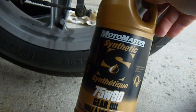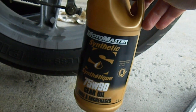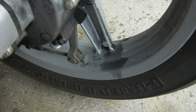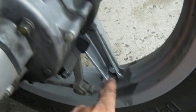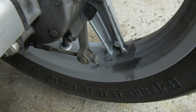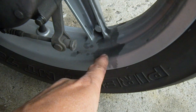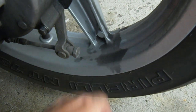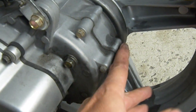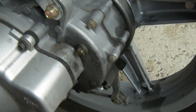For the gear case I'm using proper gear oil as opposed to engine oil. I've measured the amount of oil I got out of the gear case — I mentioned I was concerned about oil drips, which is gear case oil dripping out. I found I've got about 0.17 of a liter, so I've lost about 5% of the oil. I'm not going to worry about it too much. Eventually this oil leak will require fixing, but for the time being I'm just going to let it run for another couple of years without fixing the seal.